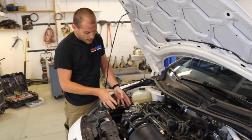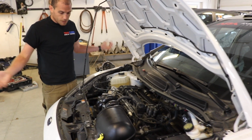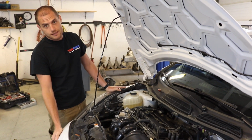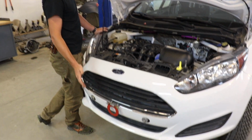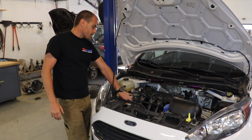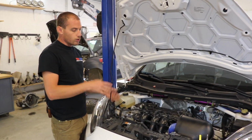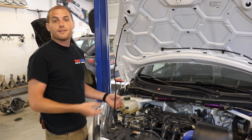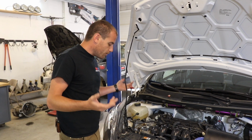The engine, sometimes if you have the option, you would want a higher output alternator, depending on what kind of electronics you're running in the car, specifically lights. Some of the new LED lights that are out there are really great. They use up very little power, they put out a ton of light, but still a higher amp alternator. Again, if you get a base model car, often you'll find a more luxury version of that maybe, within the same manufacturer. It's not like you have to go buy a racing alternator. You just find one that's a little higher output and you go with that.